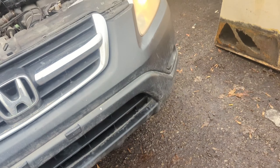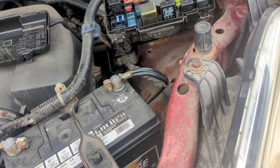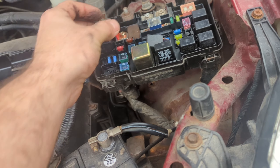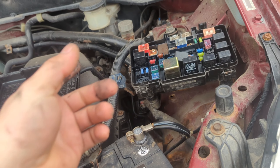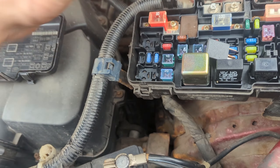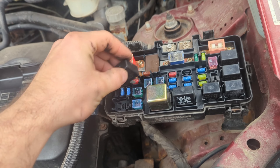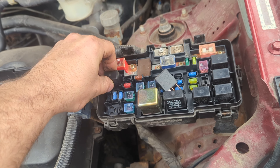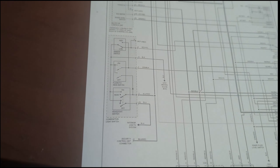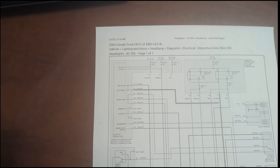Right now the key is off and the switch for the lights is off. I was going to just get this done but then I thought it might actually be a decent video. Right off the bat I can tell that the left light is extremely dim and the right hand light is extremely bright. So I believe there's a short going on somewhere in the system — where exactly, I have no idea. But for the headlights to get power and click on when everything is off means that the ground control for the relays is being activated even with the vehicle off, which is not good.